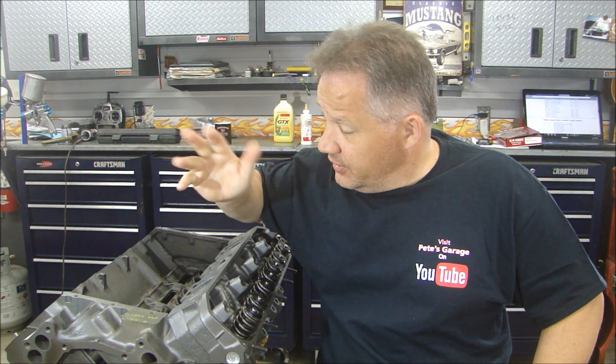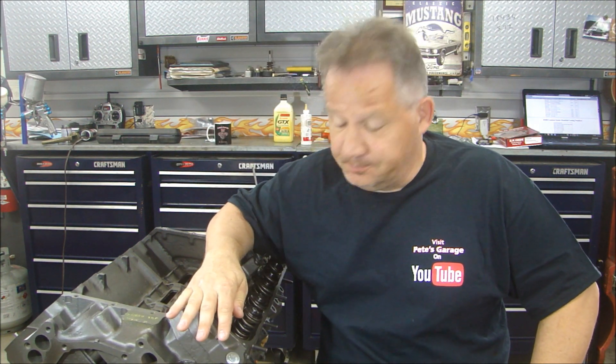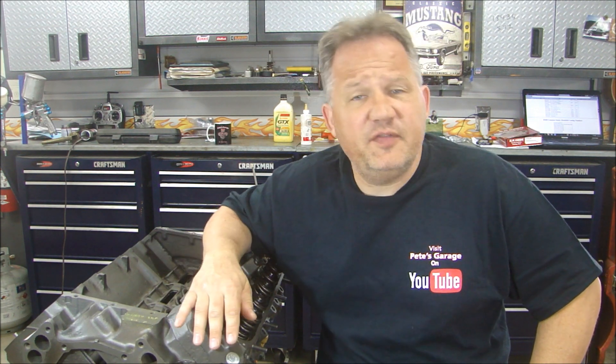So the differences, besides the internals that we already put in, now we're using cast iron heads instead of aluminum heads. These are 452 heads, which means the casting part number is 4,006,452. These are from the factory, made 76 through 78. These are an 88cc head. The valves are 2.08 inches on the intake valve, 1.74 on the exhaust — a very good breathable size for this engine. The cast iron, of course, is going to be a little heavier, but you should be able to get a set of 452 heads for 150 bucks a set.